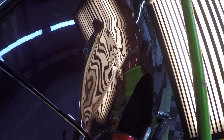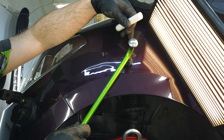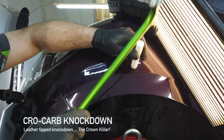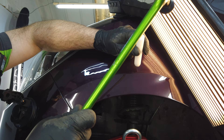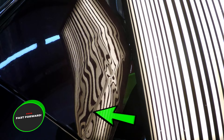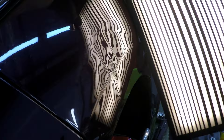The selection of tools I'll be using includes a blending hammer and a couple of knockdowns with different shaped heads. The first knockdown I'm using is a cro-carb knockdown — because it has a domed, almost flat head, it helps move a lot of metal quickly without any risk of damaging the paint surface. If you watch carefully you can see that when I'm tapping the crown down it's releasing the pressure — you can see this because the metal's moving underneath the knockdown. The panel edge where it meets the bumper is incredibly strong and hasn't moved in the impact, but the panel has flexed and created a really sharp crown that's difficult to smooth out.